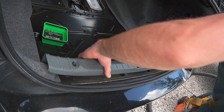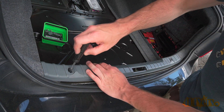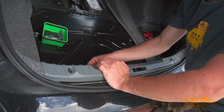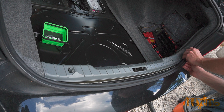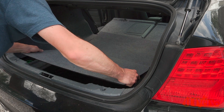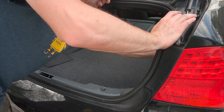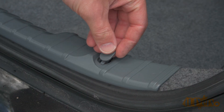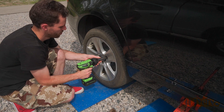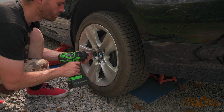Install the plastic trim panel back into place, clip it in, then install the two Phillips fasteners. The rubber trunk gasket is pushed into place, and finally finish with the plastic retaining clips that were removed earlier. Install the trunk floor carpet and the side battery access panel. Install the caps on the fastener holes. Finally, install the rear wheels — the torque specification for the lug studs is 88.5 foot-pounds or 120Nm.